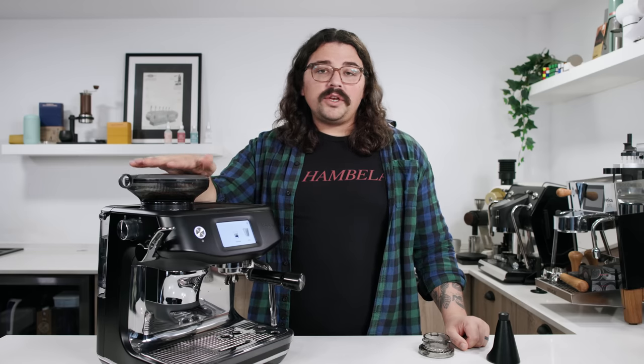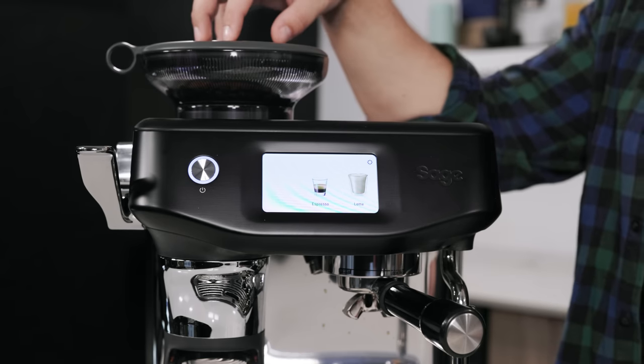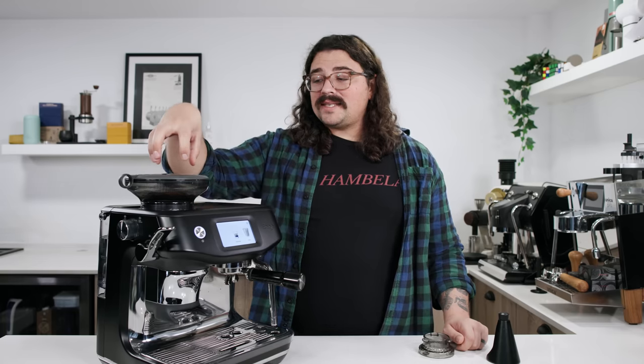You still need a hopper-fed system to give you consistent output, and make sure the hopper has beans inside for a consistent push through. You need to purge out coffee between grind adjustments. They say it might take two to three shots to equalize. I think you need to purge about 10 to 15 grams of coffee when you make a big grind adjustment, and about 5 grams for just one step. There are also third-party companies that sell bellows fitting this aperture so you can single-dose into it and get essentially zero retention.